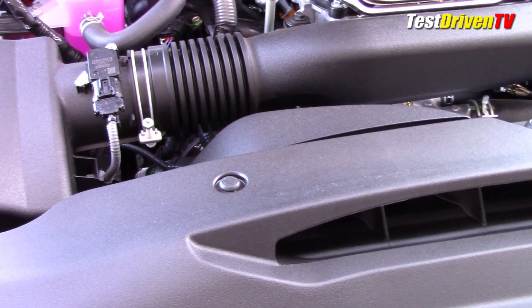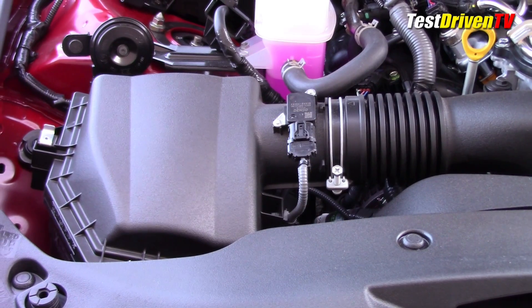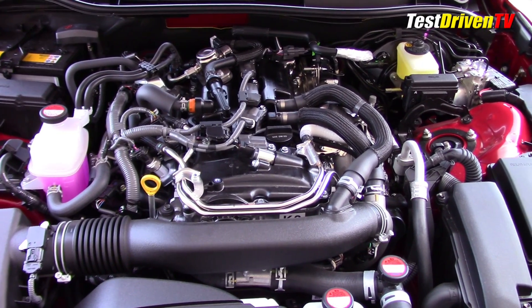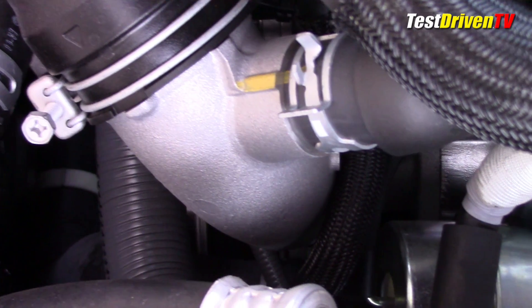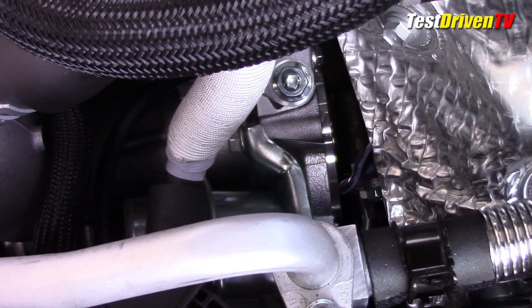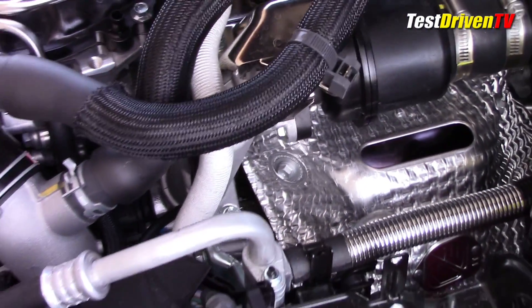Making it unique for the IS and GS is its plumbing, which starts with the air intake just above the grille and leads to the air filter box on the passenger side. The air then leads around front to a twin-scroll turbocharger on the driver's side. Each scroll of the turbocharger is fed separately by cylinders one and four and two and three respectively. This is accomplished with a water-cooled two-plane exhaust manifold integrated into the cylinder head — one half managed with a bypass valve, the other a waste gate.